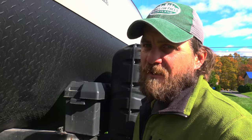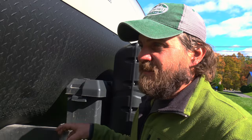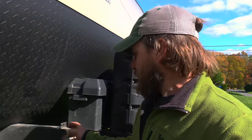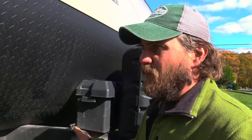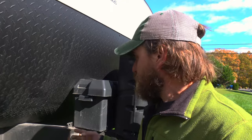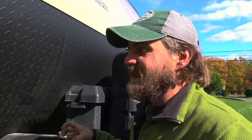When the new rig showed up at the dealer, I had them send me pictures of the battery compartment. While it is bigger, it's like Forest River intentionally screws you into using only group 24 batteries, so the space just isn't there. I could have probably done the same modification, but I'd have had to buy new bracketry because the space between the rails is longer. And I didn't like what I was having to deal with regarding the propane cover — it just wasn't working out.